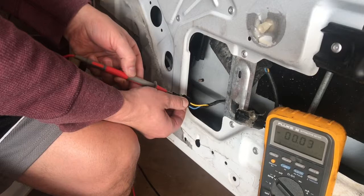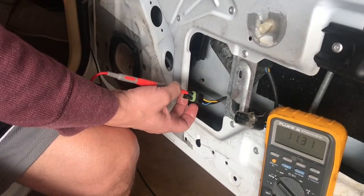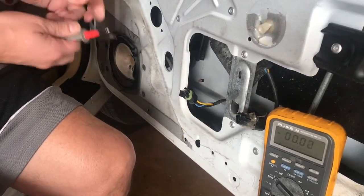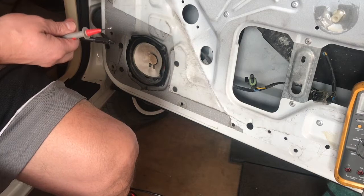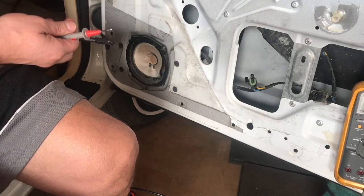So we check the other probe and the other terminal for the up position. It's the same thing. We have voltage. So we know we have power going to our motor. This would help you diagnose, was it the motor or is it the switch? If you had no values there, then you want to go up to your switch and check the terminals at your switch,